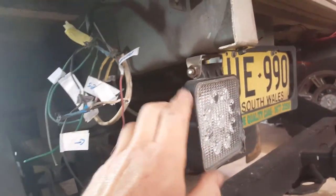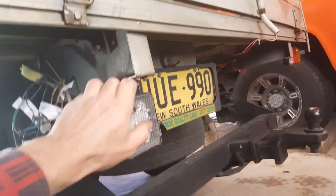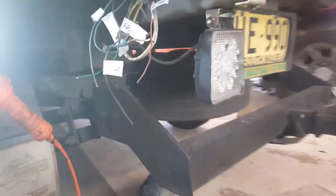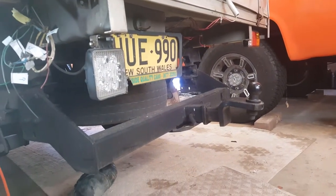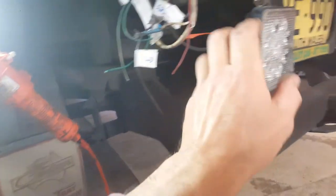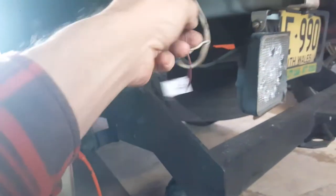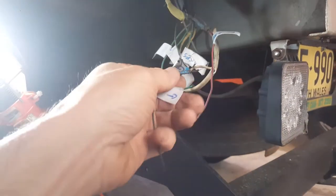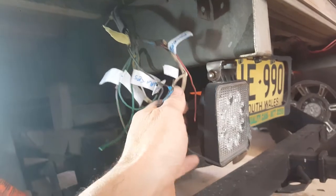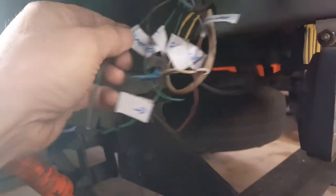This at the top here — this is an upside-down right-hand unit. It's a bit complicated because I've got the reverse light going into this cluster. Do I need the reverse light? No — these LED lights put out a fair amount of light. The reverse light actually gives you the light you need to back up. I'm going to keep it though because you don't know — one of the other reverse lights might fail. So there's reverse there, the ground stays connected to this cluster.